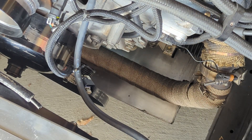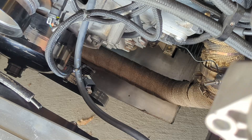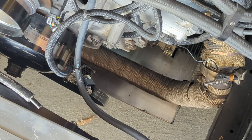Just like that, the alternator is out — super easy, not much to it. For reference, there's the stud on the back and the four-pin connector. This alternator actually does have the larger pulley on it already, but I damaged it quite a long time ago, so it's just a backup. It still charges when I'm sitting at idle or cruising along, but going down the track it does not fully charge. So we'll get this replaced and give you a comparison of the two.